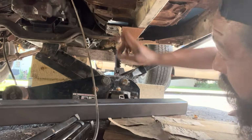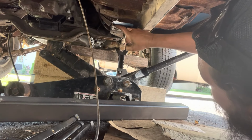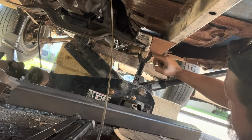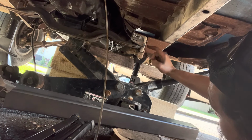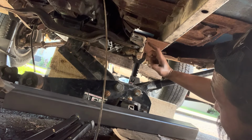I have the crossmember here, frame rail here. The frame rail's got a curvature around this. I'm getting rid of all of that. There's some flat stock plate bridging the actual frame rail to the trans mount sections. So basically I got angle iron, I got flat stock.